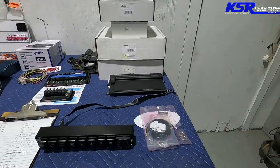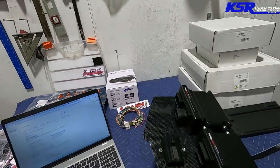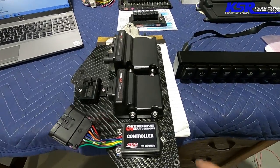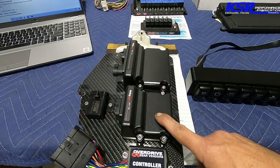The first thing to go over is what parts we're putting into Mullet. We have the Holley Dominator ECU, we're running their extra injector module to run two sets of injectors, and we're running the Holley 8 EGT module to monitor EGTs. That module brings all its information in through the CAN system, so it does not use up any of the inputs and outputs on the Dominator. I've started working on the base tune, planning all my inputs and outputs, and we're almost used up with the Holley Dominator — which is a lot of sensors.